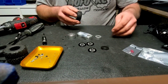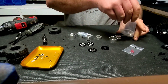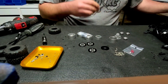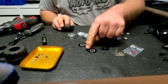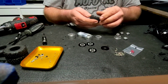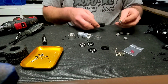First off, we're going to take one of these assemblies and the hubs. Since this is the UPW and not the DDP — with the DDP you can install using only the main hub screws for the beadlock itself — the UPW with the larger rings like this, you actually have to install them via the outer ring screws. I'll go ahead and put the ring inside the tire, make sure it is all in there nice and straight by kind of fondling it and applying light pressure. When it feels like it's pretty much in there straight, it's probably good.